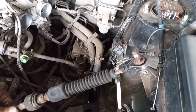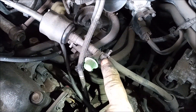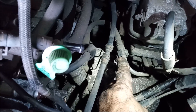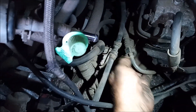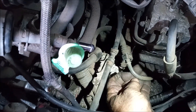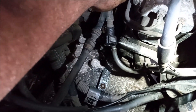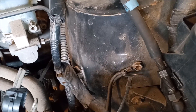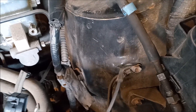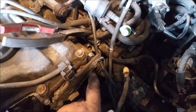So here we have the shift cable. We're going to disconnect the evap hose from right here. Next, the fuel hose. This has tabs that you squeeze. The fuel hose is off the fuel line — you can see one of the tabs on the top and there's another one like it on the bottom. Let's not forget this ground wire right here.